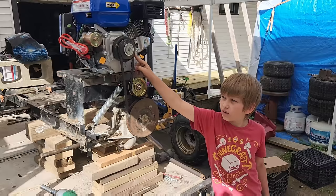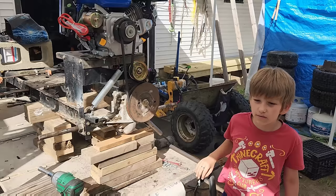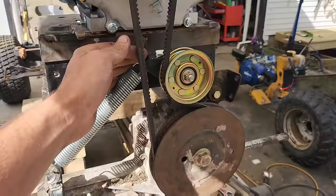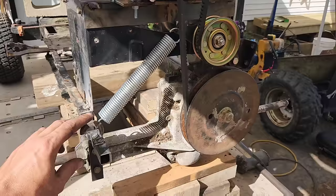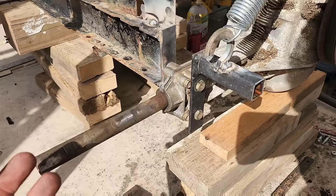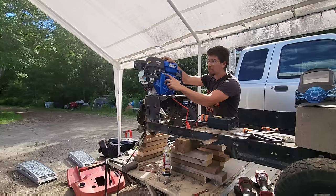It's going to go around, go to a flat pulley, then go back to the go-kart clutch - so that pulls on the idler pulley to keep compression here. We've got it a little bit too tight right now, but we can put in a link or two to change that. Really what we should have is a loop with some threaded rod so we can change the tension, which I'll weld in later. This was just a quick piece of scrap to get it up and running. We've got our gas in the on position, choke over here to start, and it's down to the slowest speed right now so we'll be able to pump the throttle.